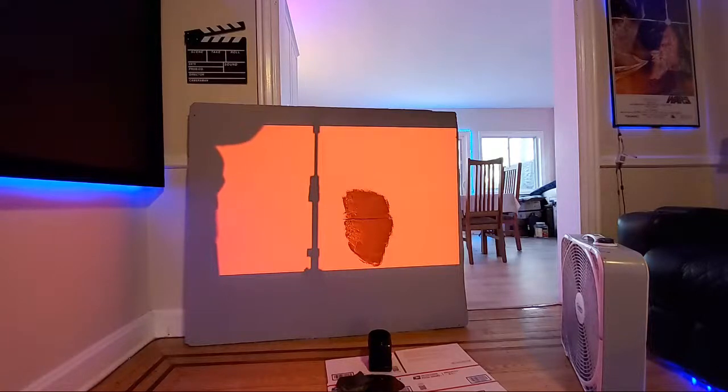So anyway, he bought a Christie 505. He turned it on, and the screen was really, really blurry. I'm video chatting with him, and I can't figure out why his screen is so blurry because I own the exact same projector. Then I say, do me a favor, pull the lens out. So he pulls the lens out, and the lens is busted in 3 different areas. I'm like, yeah, that's what it is. Your lens is busted. I've got an extra one in the shop.